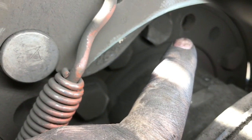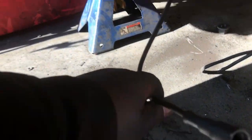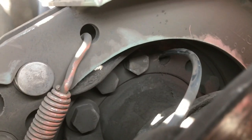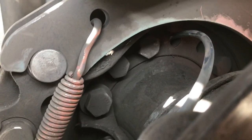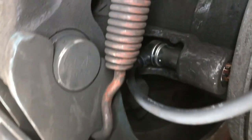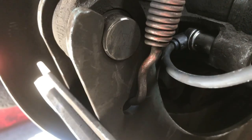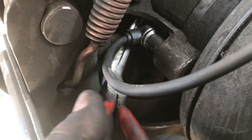You see the hole — that's where the sensor goes. You got to push it through there. I put some lube on it. The two-way plug on that part — you got to push that through the hole in the back of the hub. I put some lube on it and you just work it through using the same needle nose pliers I used to put the retainer clip in. Just pull it through, then push the sensor all the way back in.